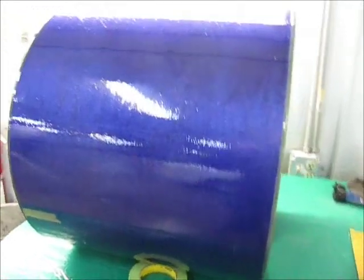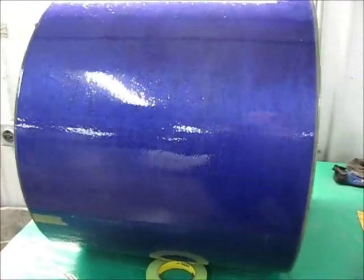We've allowed this shell to dry a couple of days. It's probably sucked up a little bit, but as you can see the surface is extremely rough — surprisingly rough, actually. What we're going to do is level all of this out. It has to be completely smooth. We're going to sand it until all the shiny is gone.